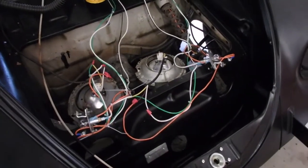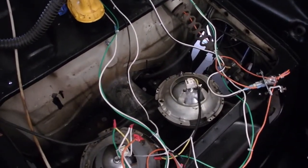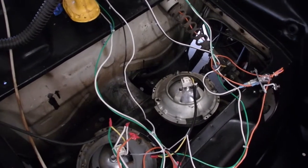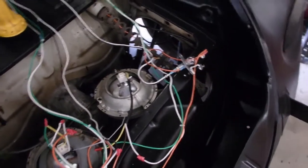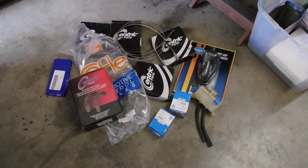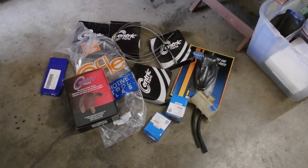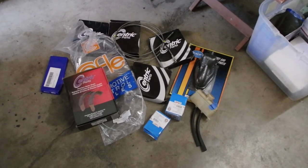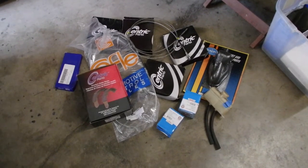The reason why I'm doing this while the wiring is a mess is my brake lights are stuck on, and I think the switch down on the master cylinder is engaging because basically the brakes are failing because they're leaking and there's no fluid in the system. So I have to do some repair work, and while I'm in there, I'm going to upgrade all these other little bits and doodads so that I have a nice firm brake pedal. The master cylinder is not signaling that there is a brake failure or that the brakes are on. So here's hoping that it goes as easily as I just explained it.